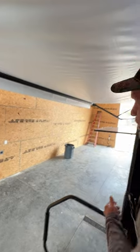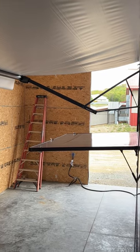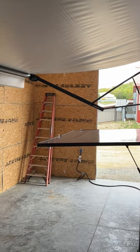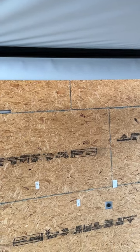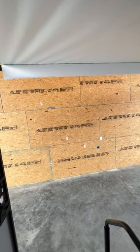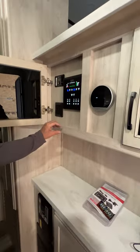On the awning, each one of the arms has a bottom bar that you can pull down on to put the pitch of rain coming to that side — the back side or front. Most of the time you'll want to put it towards the back so you don't have water dripping off your canopy right in front of your front door. The bar has to be pushed back up straight in line before you run the awning back in. On a really windy day I'd always prefer that you put the awning back up if you're not using it — the awning is one of the more expensive pieces you have to put on the trailer and it can be ripped off with wind or rain.